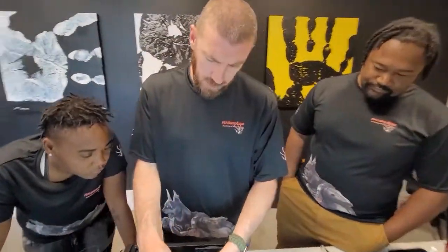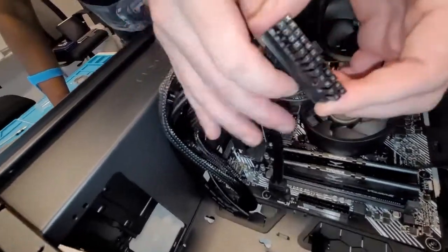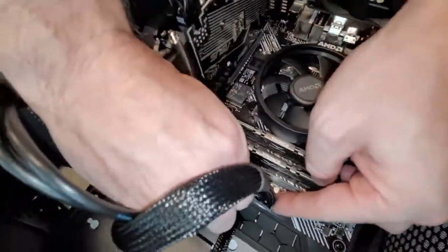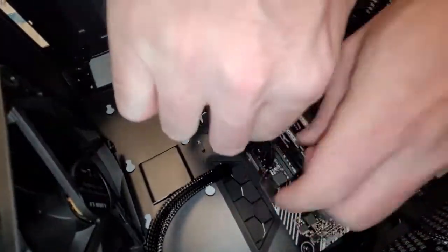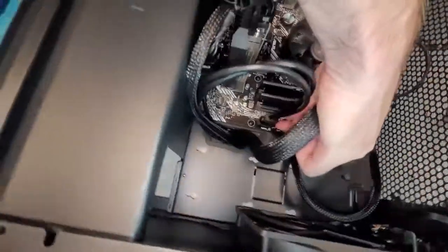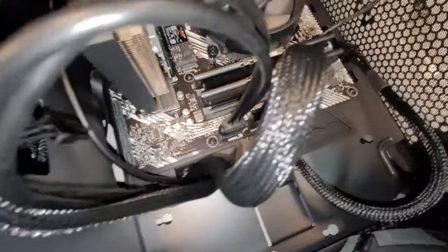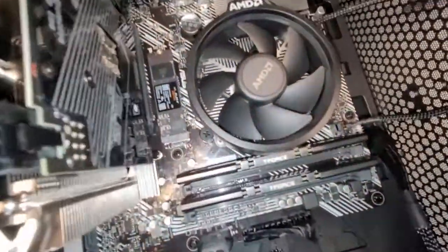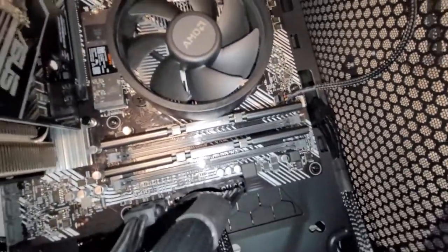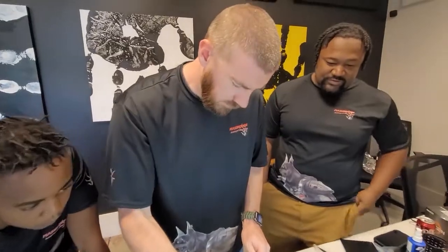Next is going to be the motherboard power. Put that on there. Flip it around. And it's the same type of adapter, same power adapter style, because some of the other motherboards don't have the multiple plugs on them. That's it. And that's why you also want to make sure your motherboard is level, because just like how you had to push that in, you don't want to break that. You can break your motherboard, right? Exactly. Just trying to push that power in because it's a little tough.